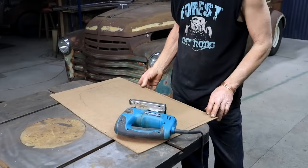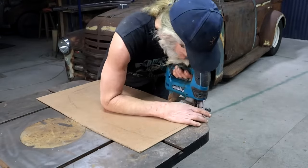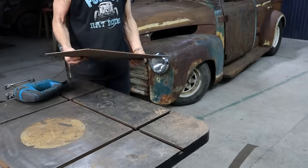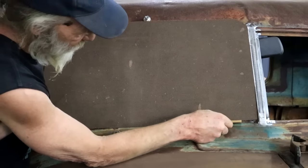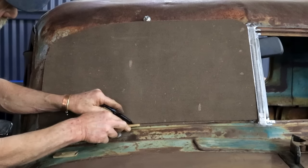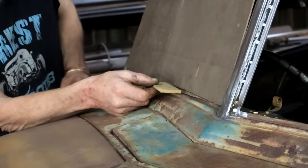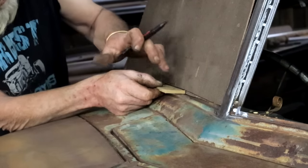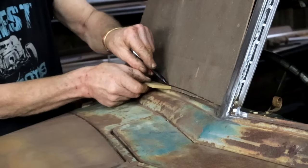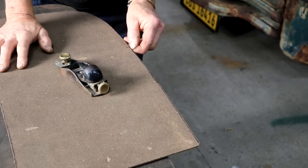I'm going to do a rough cut first and then try it again, mark it and fine-tune it so that it fits nicely. So it's still too big, but I knew that. Now I can refine my shape. Boat builders call this technique spiling — S-P-I-L-I-N-G. By riding this bit of wood on that bottom surface and marking it, it actually transfers the curve to my pattern. I'm going to keep trimming my hardboard piece until it's a nice fit in that window recess.